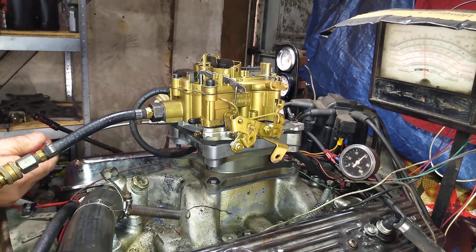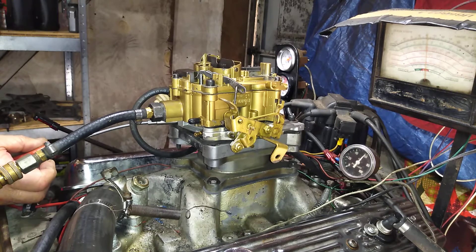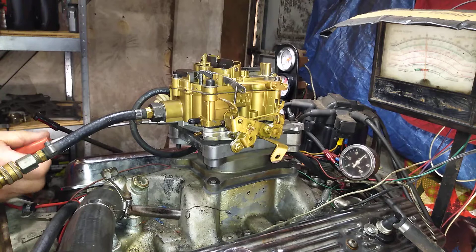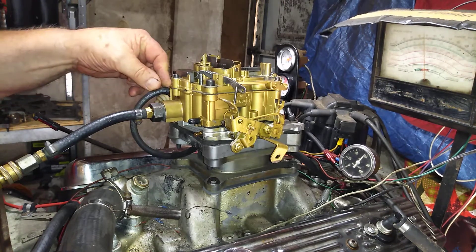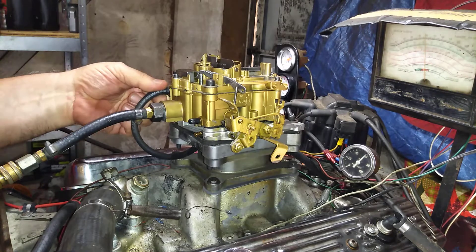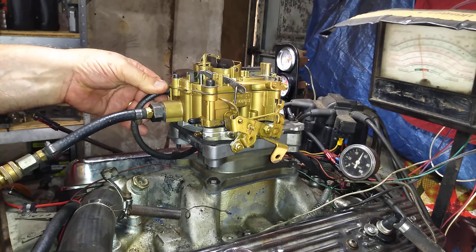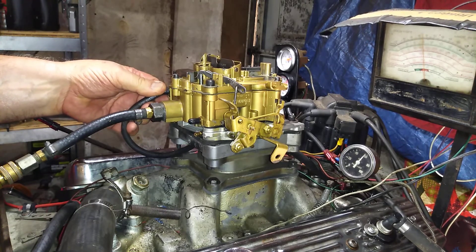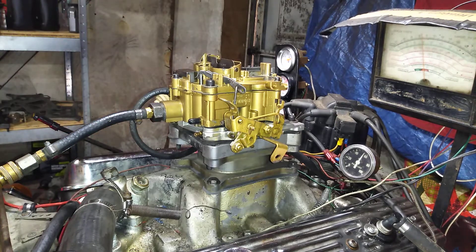Out there it's almost shut off. Uh-oh. You done sucked in a big old mouthful of dirt. Like I told you, that pipe right there was full of dirt — I had to drill it out. So I don't know if that comes from your gas line or you were dragging it along the ground from insulation. But I'll tell you right now, this side of the carburetor is not working.